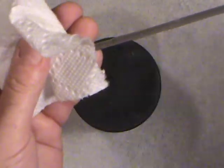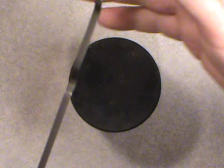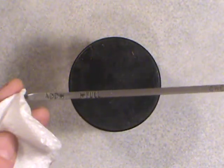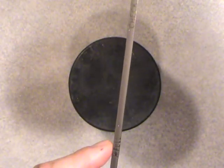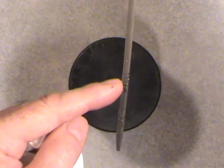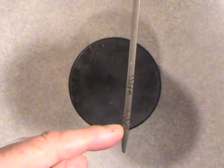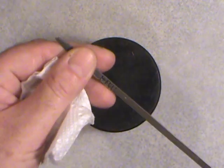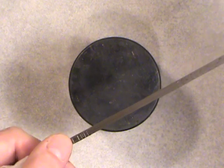Okay, I'm going to do this dry so I don't have to get oil all over the place, but I'll still be doing that, I guess. So you'd want to do, I'm probably going to be on a bit of an angle. You're going to be in this orientation when you pull it out of the engine. It's going to be vertical or slightly to one side, but for the video I'm going to go sideways a little bit on you. You actually have to read the oil when it's horizontal too, otherwise if you have it vertical when you try to read the oil level on there, with Earth's gravity it'll probably draw it down and give you a false reading. So what you want to do after you withdraw it from the engine is turn it so it's horizontal so that the oil will lay flat on the dipstick while you read it. If you have it this way or this way, the oil will run and it'll give you a false reading.